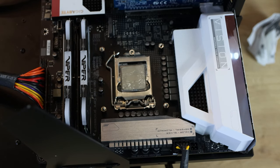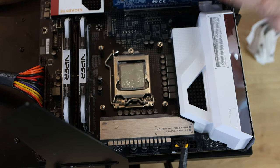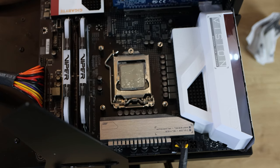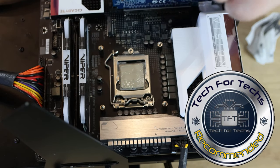That's it. Now you can take your CPU cooler and place it on top. If your cooler already has pre-applied paste, you won't need to add more. But if you cleaned it to replace old paste, make sure you've applied fresh paste before fitting the cooler — otherwise your CPU will get very hot because it won't transfer heat properly between the CPU and the cooler.